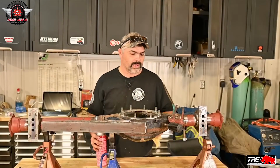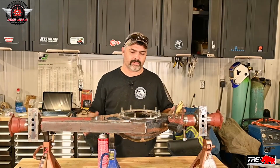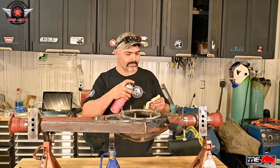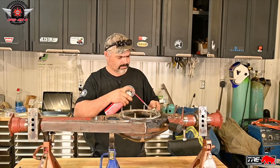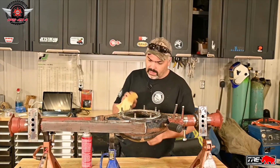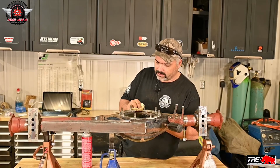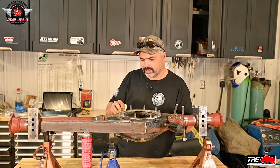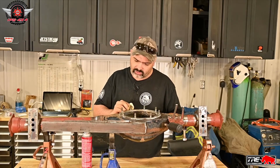Okay, the old housing is completely cleaned out and everything like that, and we're just going to clean this surface before we drop the third member on there. And like I've said in my previous videos, the cleaner you get this surface, the less chance you're going to have leaks. So make sure it's super clean.